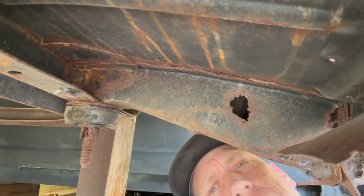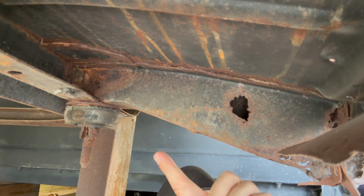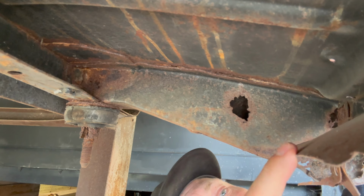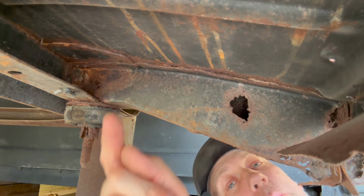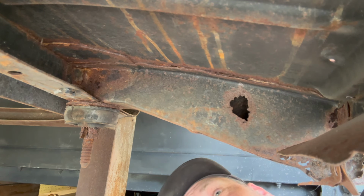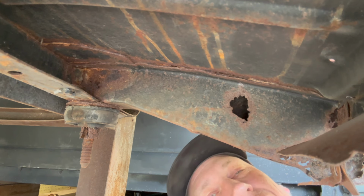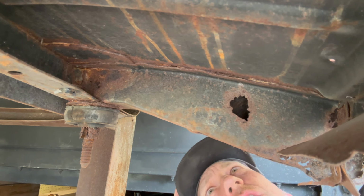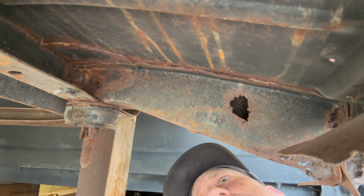Hi. So we're under the cab, and that isn't stock, and it's not good over there. It's worse here. I found some inner rocker, so that's nice. The story's even worse, or way in the back. So that's not great. I think the whole thing's got to come out, honestly. So it looks like I have to dig this whole thing out, which means I got to cut floor out. And definitely have to get that body mount off, which is rotted to absolute hell. That's great.